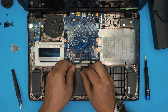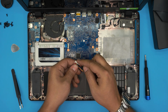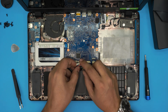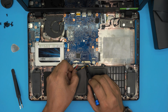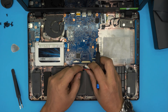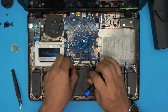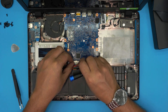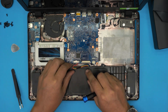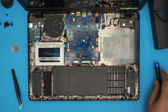When reconnecting the battery jack, make sure no pin is exposed and the white connector is facing up toward the ceiling — do not put it in the wrong way or you'll short the motherboard. The red wire is positive and should face toward the keyboard connector side; the negative faces toward the hard drive side. Bring the jack down evenly and push it toward the motherboard evenly, then tuck the cables into the gap.